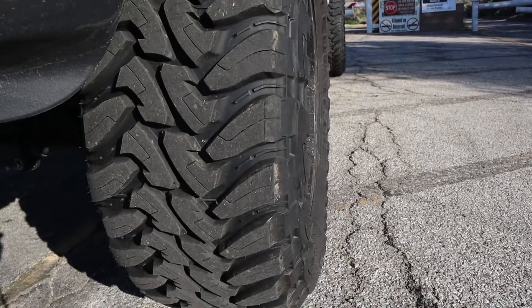We're going to talk about gear ratio. Right now this truck is on 37s and it has a 3.42 gear ratio, which is really bad for this size of tires. It's literally worse than towing a trailer full time.